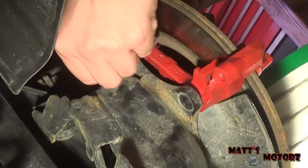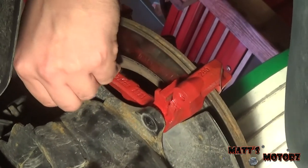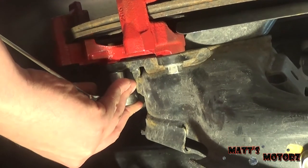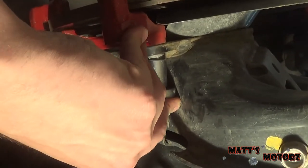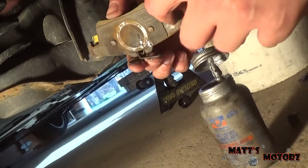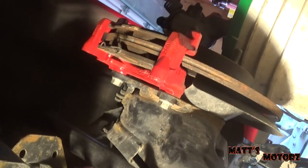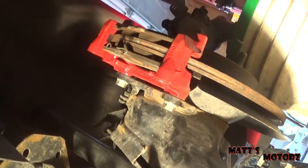Okay, we're in the rear now. We're threading in the two bolts for the bracket. Sorry. It's good. That's fine. Don't over torque it. We're gonna put that right here on this tang here. Yeah. And over here. I kind of lost some footage there, but it was just Brian putting in the brake pads that just slide in. The one with the spring goes in the back. Now we're going to put the caliper on.